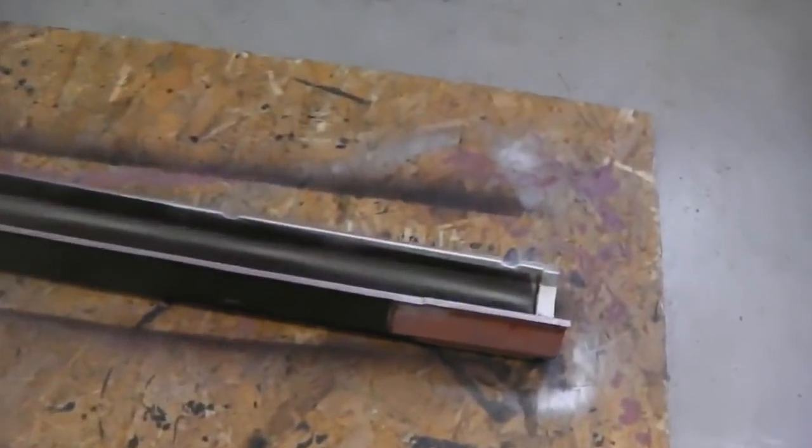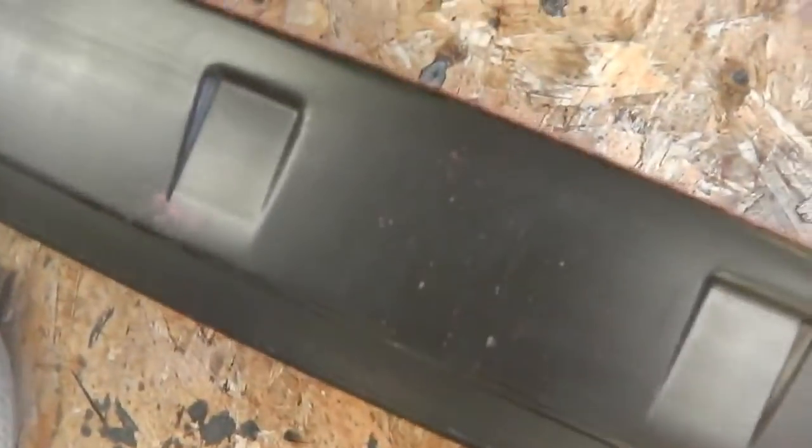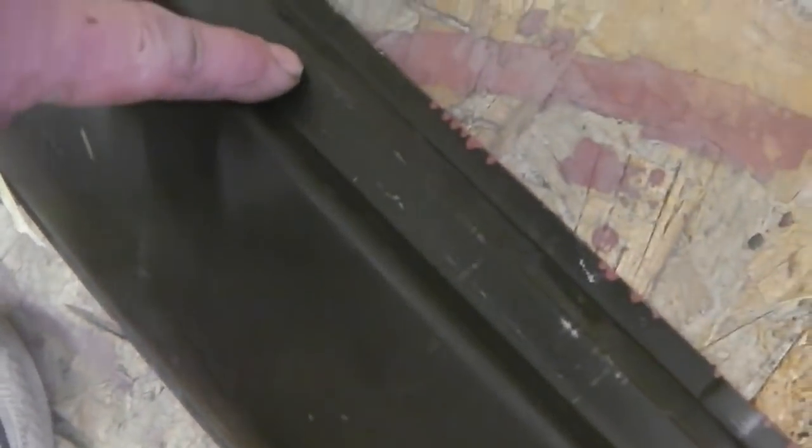So that Technogrip paint's cured. I put it on quite thick, didn't thin it down too much. A little bit slow coming out the gun, but it gave a good cover. So we've got a nice coverage on the sill. Okay, so we're ready. Obviously the outer sill needs prep, and there is probably one more area that needs the weld through that I've missed, just somewhere along here where the ski jump lands, so we better do that now.